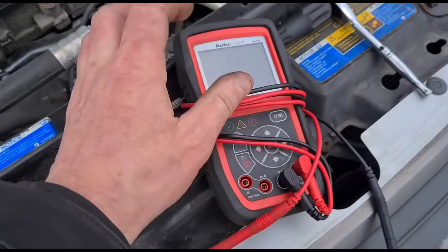We'll get access to the battery here and remove that. Having a look around, we can see there's leakage from the breather. We've also got another issue — a loose boost hose. Surprisingly that hasn't thrown a fault code; someone somewhere has left that loose. We'll get that tightened up.